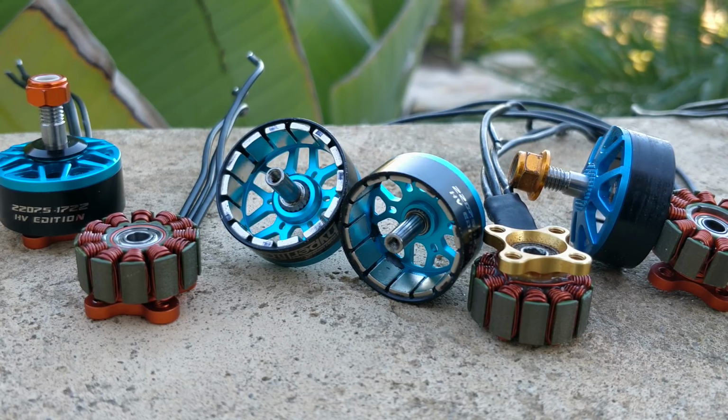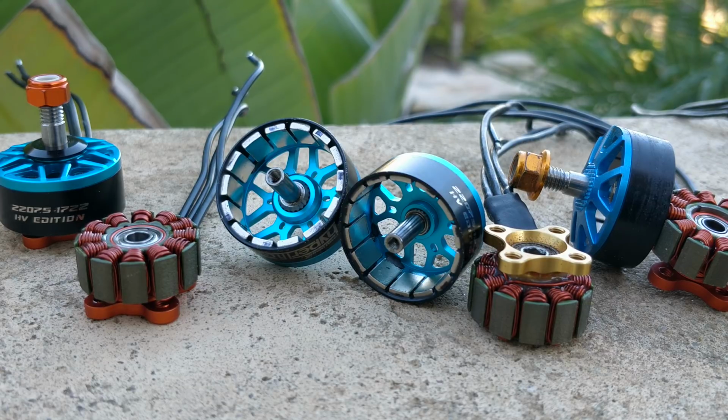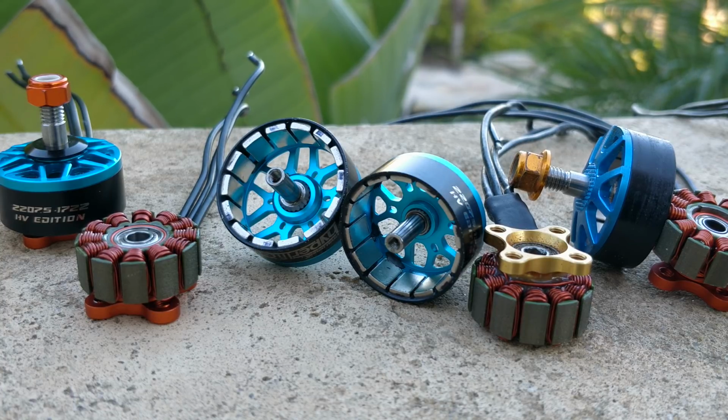because I personally think that around 1850 to 1900 kV is the perfect KV for 6S acro, regardless of what prop you use. And I'm going to go over why that is in the next video. And it's mainly because the higher KV just feels way better in the air. It just feels like it has way, way more control than the rest of the other KVs that I've tried.